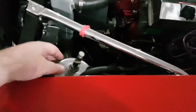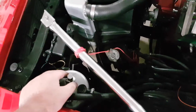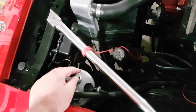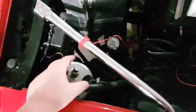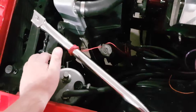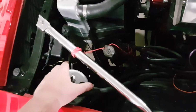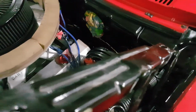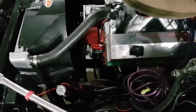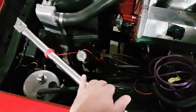and then what I had before, when I had the smaller motor in it, that had a fairly decent solid flat tappet in it. It did not have much manifold vacuum at all, but we put a band-aid on it by running this vacuum canister. So this just stores extra vacuum, because the motor would make some vacuum when it was turning up quite high. So this is just added storage of vacuum along with the booster. So while you was idling, you would be able to probably pump your brake pedal 3 or 4 times before it got hard and you lost power assist.